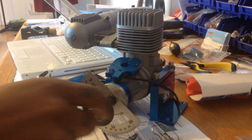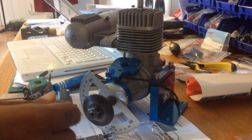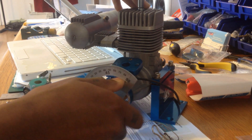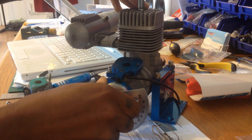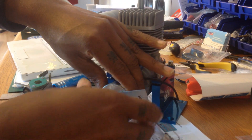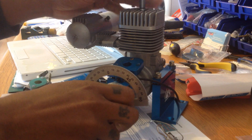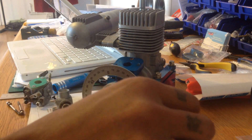So what I want to do now is find top dead center. I'm going to use my piston stop to help me locate when the piston comes up. I'm happy with that right there. So what I'm going to do is just try and rotate this on top. Tighten it up again and try to see if I have top dead center. I'm happy with that. You can see it is zero on one side — I'm not worried about that.